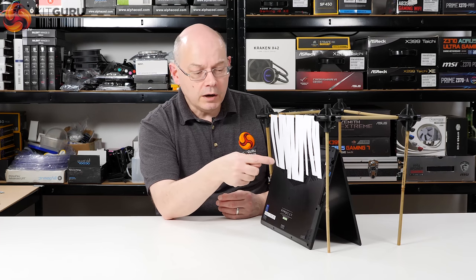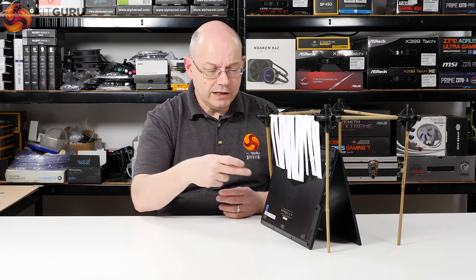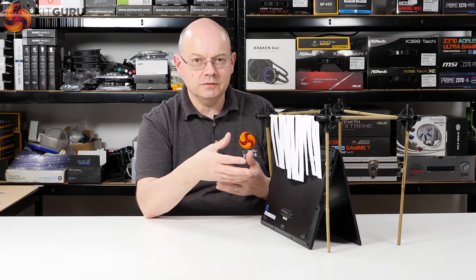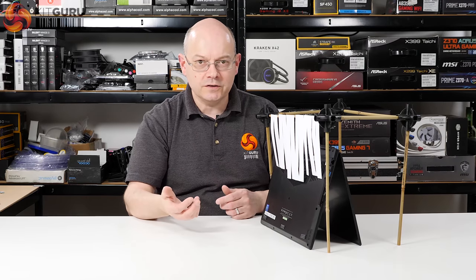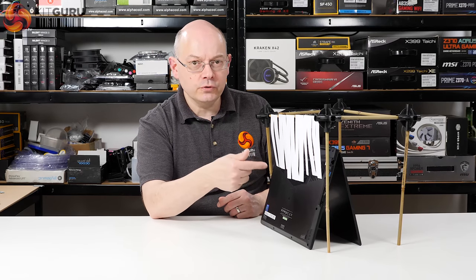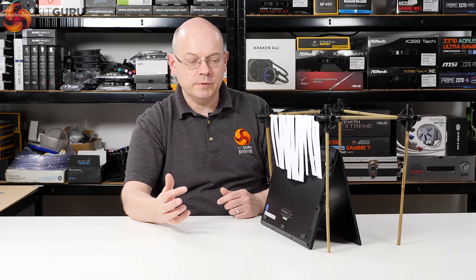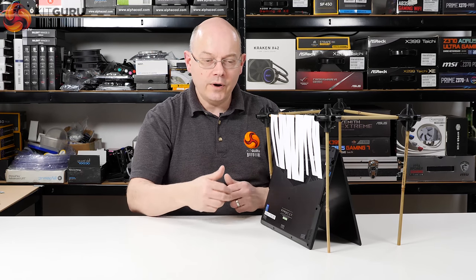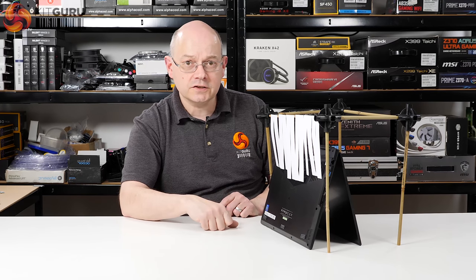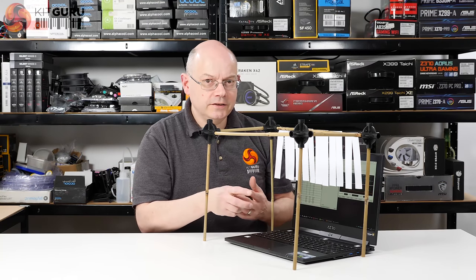So that's my bad — I got that wrong. That center vent is doing next to nothing in the grand scheme of things. My view — and I'm waiting to hear back from Gigabyte — is that these are clearly the primary intakes for the fans, and the large center vent is really just disaster relief: if you put the laptop on soft furnishings or your legs, you can't simply block the two fan intakes and starve it of cooling air. That big vent allows some airflow as a backup.